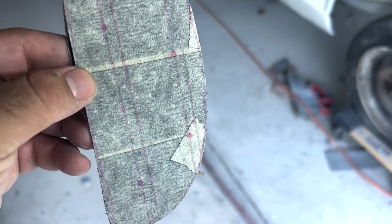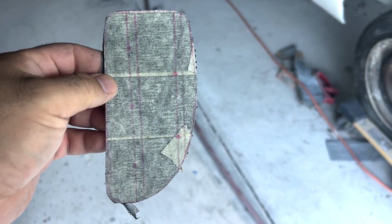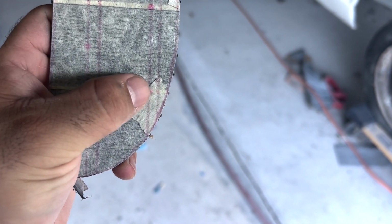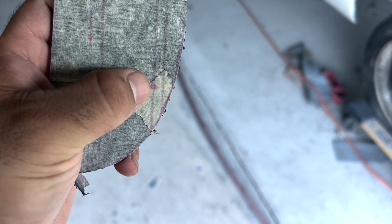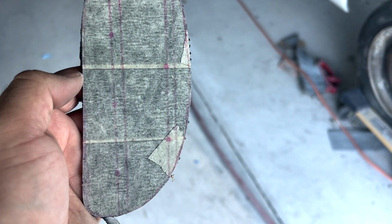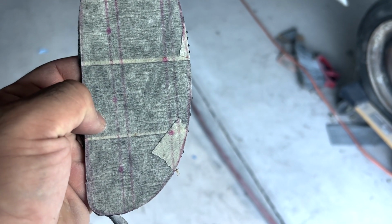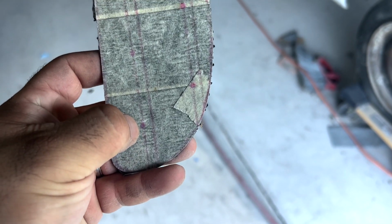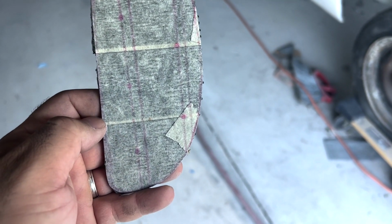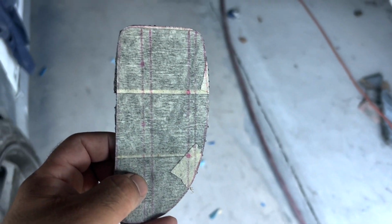So here I did the drawings and where I'm going to put the screws. As you can see, some of these are really close to the edge, and these bolt holes are going to be fairly big. So if you feel like it is going to be way too big, then move it right on over. I still don't think this is a straight line, so I'm going to go ahead and fix that and then put the bolts. So I'll probably drill this a little bit over, knowing that this is a little bit more this way. It doesn't look weird or off. So let me go ahead and start drilling now.